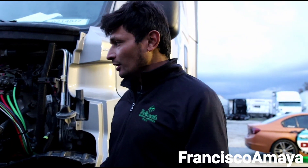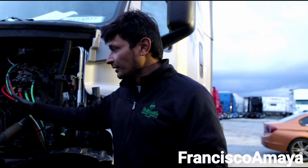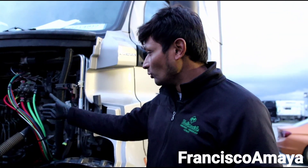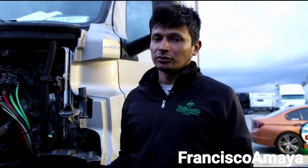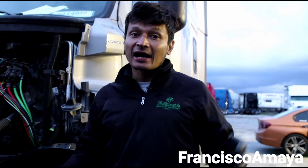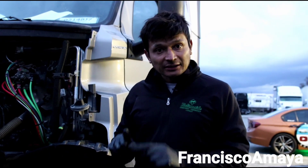We've got the twist-off fuel filter, which is easier than everything. The oil change process — how to drain the oil, how to bleed the air out of the fuel filter housing, and how to replace the oil filter — is pretty much exactly the same. You are not going to do anything different whether you had an older Cascadia or now have a newer Cascadia.